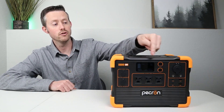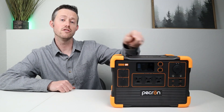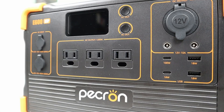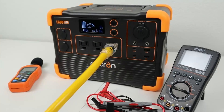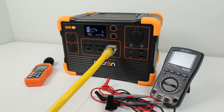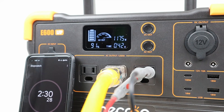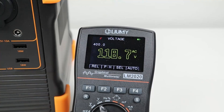In the next part of the video, I want to test the AC inverter — this is for running appliances that you plug into your wall outlet. Looking at the front of the E600, you'll see three AC outlets. The first test I like to run is a max load test for 15 minutes to see if it can handle the rated output without overheating. I was pulling slightly under 1200 watts continuously and using my oscilloscope, I was showing a pure sine wave output at 60 hertz with just a little bit of distortion. Using my volt meter, I was getting around 118 to 119 volts output — very little voltage drop even at max load.